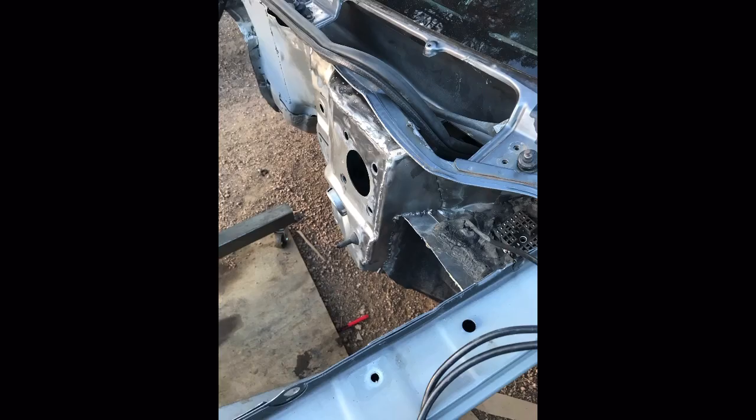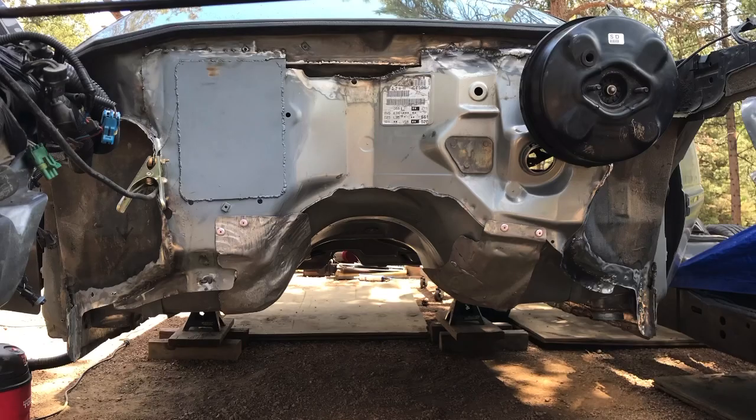Moving on to the front, this is the area that I was talking about from before, where it protrudes further from driver's side to passenger side, so I welded up a filler panel and welded it in place. As for the rest of it, this is really the best picture I can find. I know this isn't the last one because I welded in little splash guards to block off the body mounts in the bottom two corners, but either way, it's the best picture I can find to show how I manipulated the metal and made it work and welded it all together for a finished product.